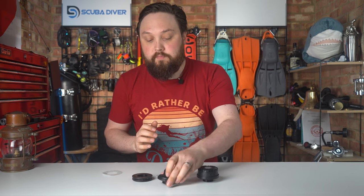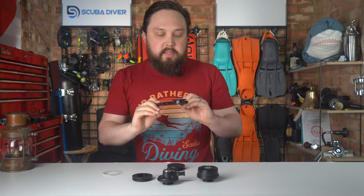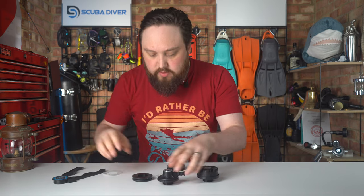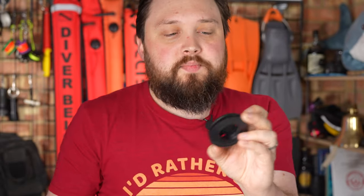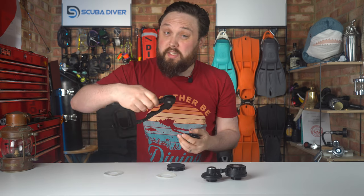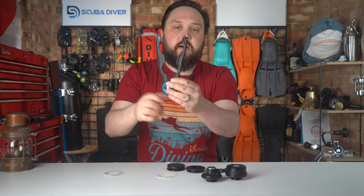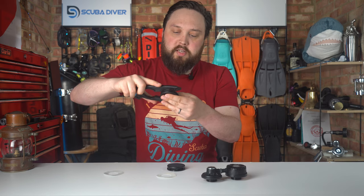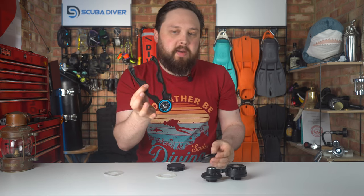You can swap them over — just make sure you get the right size, the right diameter. You do get special tools. There's the Cytec combi tool, and around the side of these halves you get these little notches. You can do a lot by hand, but it's quite nice to use a tool, especially to undo them, because when they're put in at the factory they're usually done up quite tight. The combi tool has notches that line up so that when you're trying to undo it, you get some torque to be able to wrench it around. That makes your life a little bit easier.